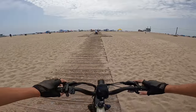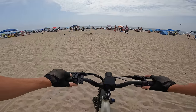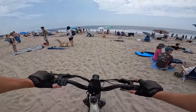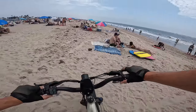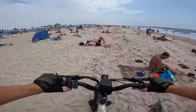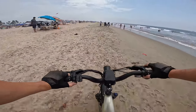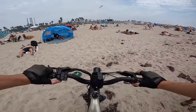Let's try this thing on the sand. Shifting down a few gears, full throttle — oh yeah man! I'm not even really pedaling much, just have the throttle pinned. It actually helps a little bit to pedal. This is a really strong performing beach cruising, sand riding bike relative to most bikes I try on this channel. These 26-inch tall tires with 4-inch wide knobby treads at about 18 psi — if you drop the psi a little lower it could probably do even better. This thing is just wrecking shop with no problem at all.